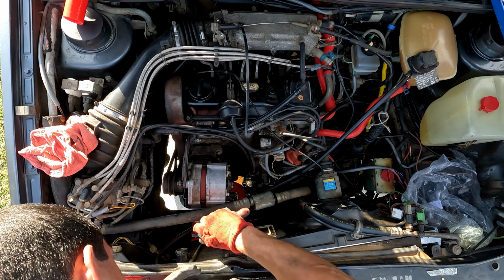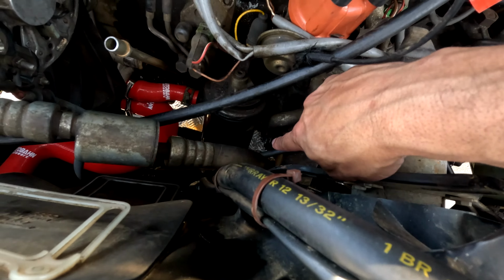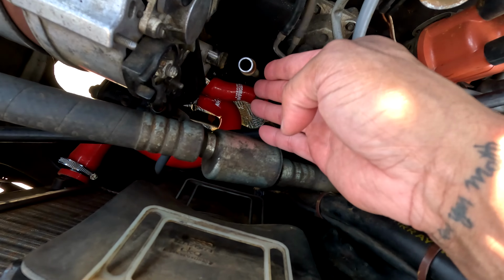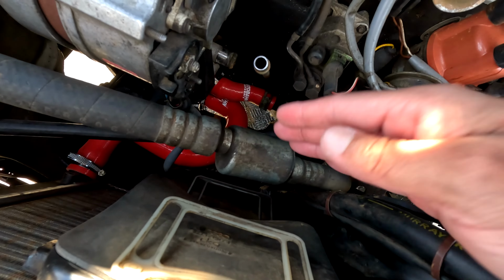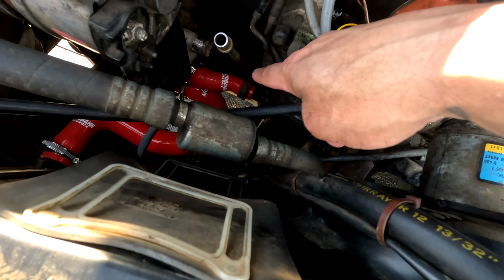We are making solid progress, and actually the red's not as obnoxious as I thought it was going to be. I don't hate it, but pro tip, which I actually forgot when I was taking them apart, this one down there, a little crossover from left to right, actually the red makes it so bright and really easy to see. This meets a hard line over here, which crosses around up to this one. If you unbolt it right there and right under here where it locks it in place, you can move the entire line this way, giving you enough room to put the hose back on, because that one down there is an actual pain to maneuver. I cut it the first time taking it out, cut down the middle and pulled both halves off, but the new one obviously can't be cut in half. But yeah, there's a 10 right here, 10 right there, move the entire hard line up and over, and you have enough room to get the one in there.